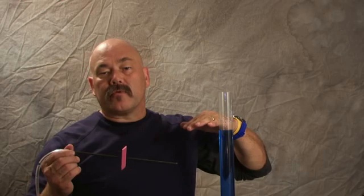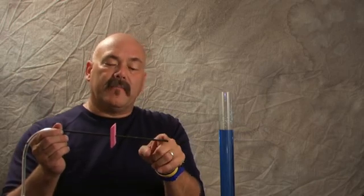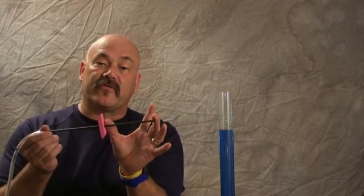Alright, the way you use this is you slightly overfill your fork tube with oil. Then you take whatever your measurement is for your fork tube and measure it on here and slide the eraser down. We'll say 6 inches on this one. We slide it down so we have 6 inches. And I've measured this with a ruler, so it is actually 6 inches.